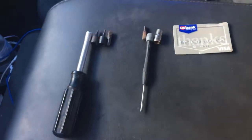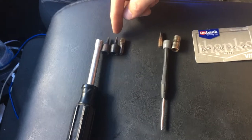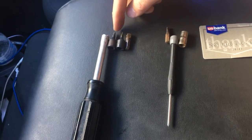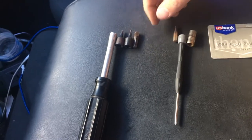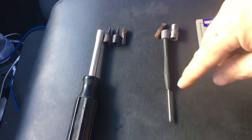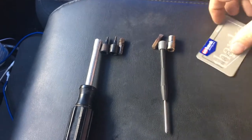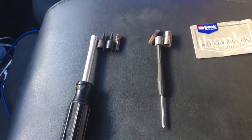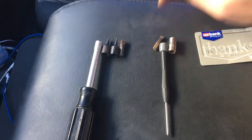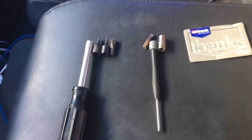So the tools I'm going to be using today: it's a regular screwdriver with interchangeable ends, a couple of Torx wrenches — this is a T15, this is a T10. Of course my little driver there, I'll need a flathead bit, a precision screwdriver Phillips, and a 7mm socket. And something I can use to wedge in there, because I don't want to use metal tools that will leave scar marks all over the plastic. So those are my tools.